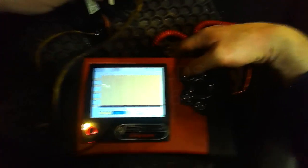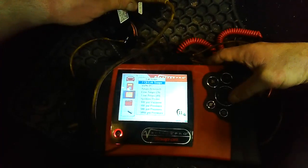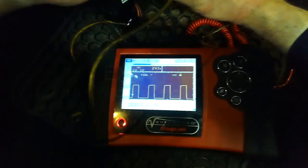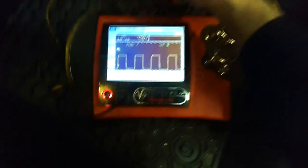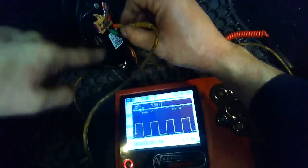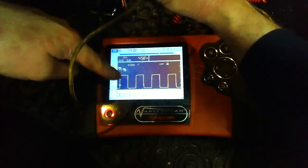Going to speed 1, 2, there's speed 3 — and you can see there is a pulse width modulated signal, so I'm going to have to go to lab scope. Right now you can see there is a 3.5 volt averaged signal, that's about half way — 50-50 almost. Let's go one more notch. That looks more like 50-50. There was a 10 volt input on the one cable, and you can see the square wave now pretty much equal — so that's 50-50 on/off.